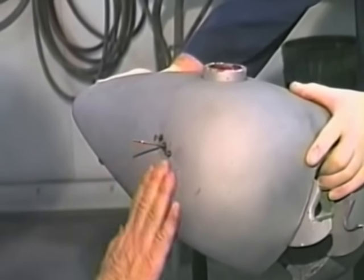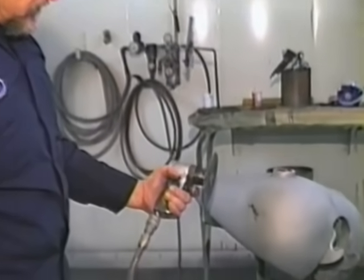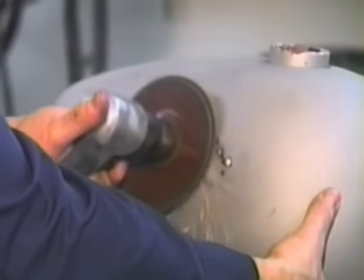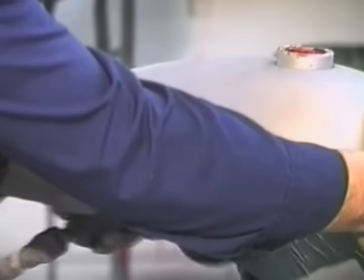We feel with our hands and try to get as close to the surface as we can. Once we're satisfied, we take a side cutter and cut the studs off, then take our grinder with a 24-grit disc and rough that metal up so that we can get our filler — our plastic filler — mixed and onto this area. We rough the entire area up, knock down any protrusions from the studs, and clean it up as well as we can.